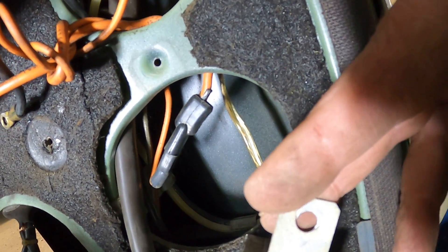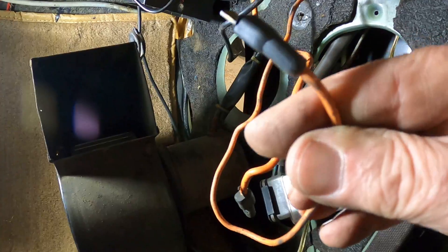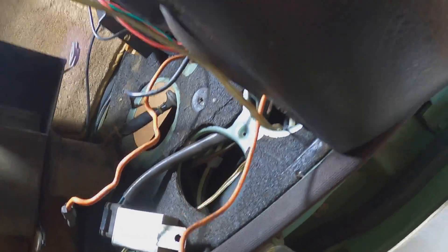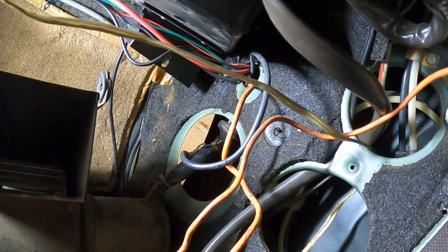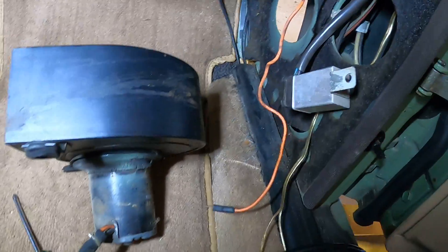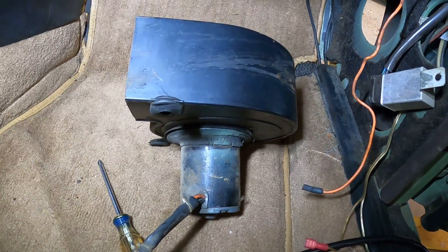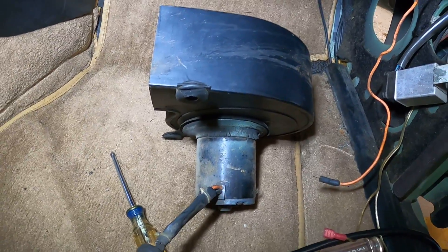I had to get rid of this relay to give me access. I undid this tangled up main power wire. This goes back to the switch, and this is the main power wire to this motor. Now that I have these things separated, this goes up into the dash and this goes out through this hole along with this ground wire. I think I can just fish the whole thing through there — this is certainly one of those victory moments. It's all out of there. Now I can put it on the workbench and see about lubricating that motor and cleaning up the squirrel cage fan in there. I think I've used up years of dexterity on this job so far.